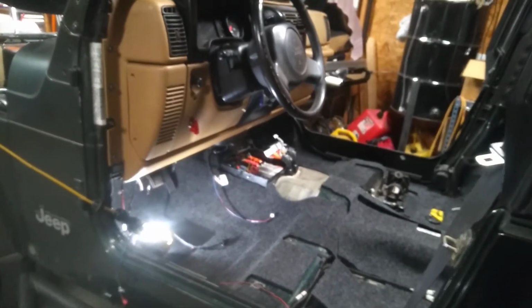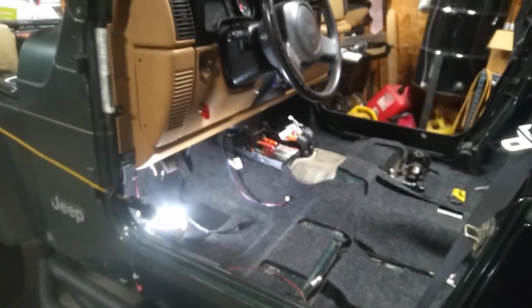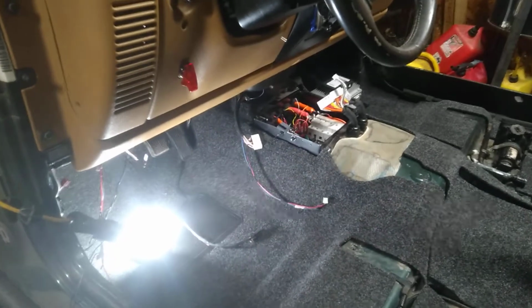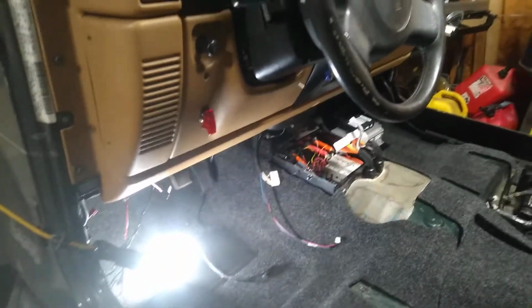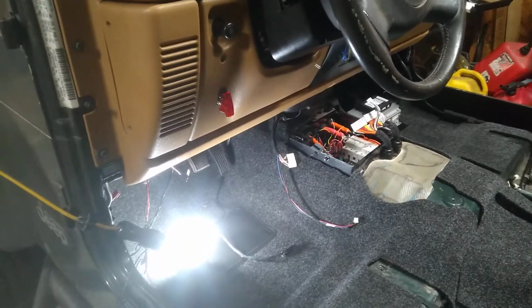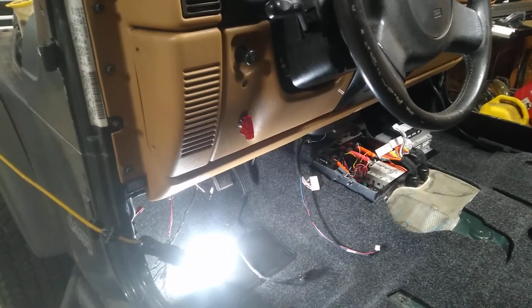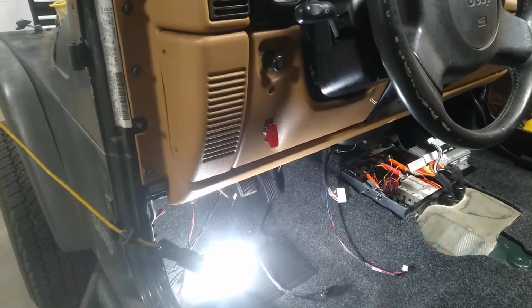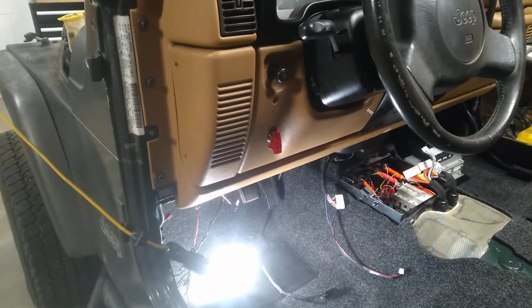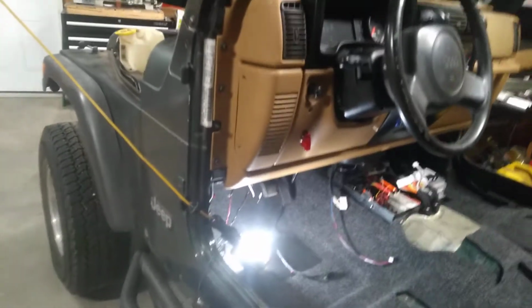So basically what I'm getting at is everything that I had that needed a signal to control something, the pre-charge relay or the positive relay in the center there, the reverse lights, there's a relay that I have to run for the reverse lights. I have to put like 4 relays in here so that whenever the EV controls controller sends out a 12-volt positive, it goes to that relay, and then the relay gives ground to whatever I have, like the fan for the inverter, the fan for the drive unit. It runs through a relay in the Jeep's fuse block, and it needs a ground to make that relay happen. So I have to have a relay to send ground to that other relay.